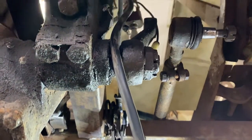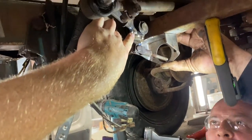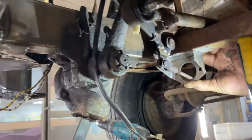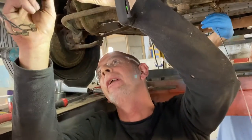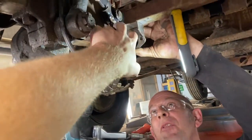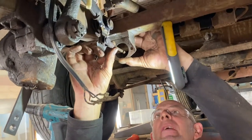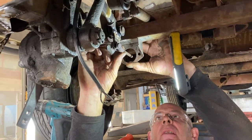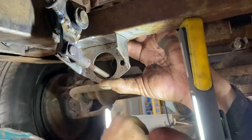Update: the brake pedal conversion was also wrong. Oh no! Was that this bit here? That is the piece I've just put on. So what, was it missing or was it the top side? It was too short and in the wrong place. Right. So when it was throwing, this hinging part was up here. So you've extended it with a new... I've used the original one, I've cut it off the original one and welded it onto this one. It's all in the right place and where it should be. So you're sitting there dead centre. Lovely. And it was up there somewhere. So it would have been pushing down into it. Yeah, just not going to work.